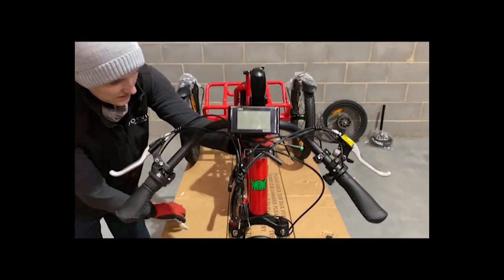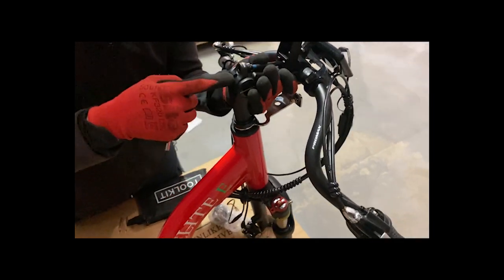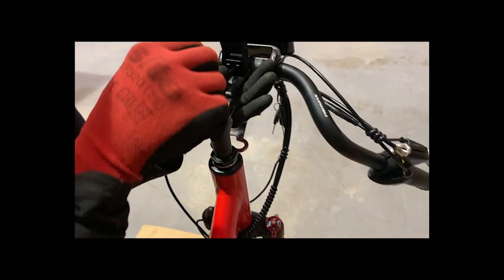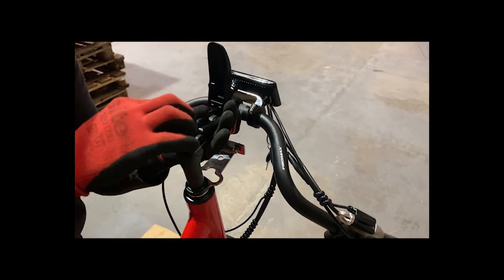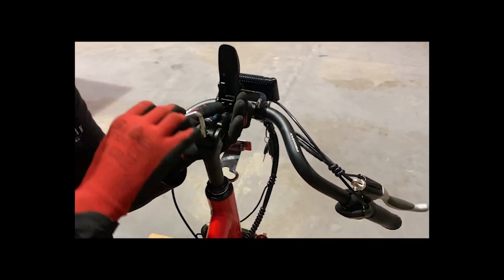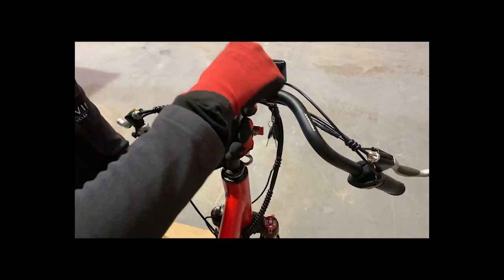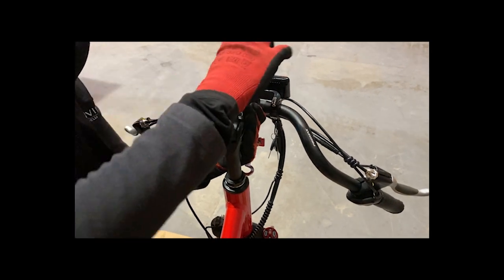If this doesn't fit straight away, if it's a bit tight, don't worry — what that just means is you're going to need to loosen it. If you watch as I rotate here, a gap appears — a little tunnel that will lead down to the number six fitting. So if it's not fitting in, pop your number six in. If it rattles around, it's not seated. What you want to do is move it until it's nice and sturdy. Twist to the left to loosen it off and that will help you drop it in. Once you're in, find the height that you want, make sure that it's lined up with the basket mount and then twist to the right. You'll start to feel some traction and you want to do this so it's hand tight.